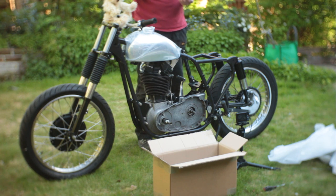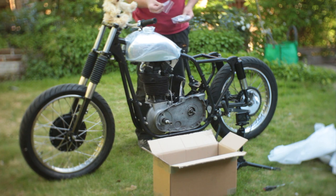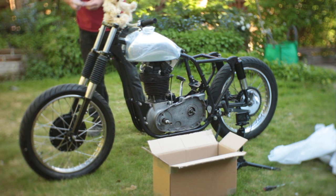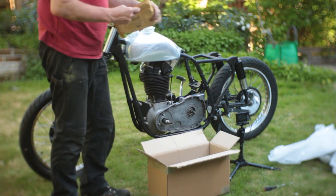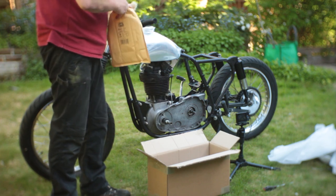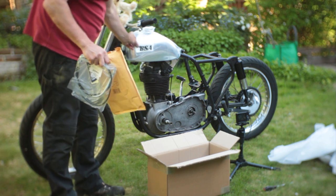This is the little pin for the front brake - there are two of them, I don't know why two. There's a fuel tap and a small piece of hose. Oh, I think this is the mounting bolt for the center stand - different for C15 but I'm sure I can make that work. This is the pin that goes through the brake lever - just check that fits. It doesn't - it's just going to need a drill to go through the brake lever.